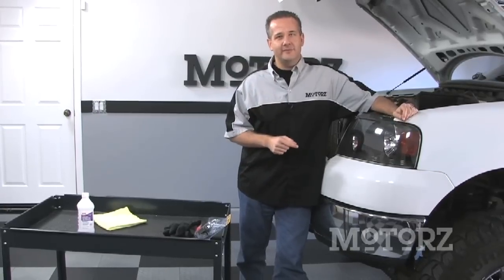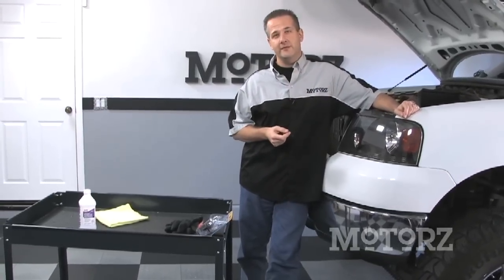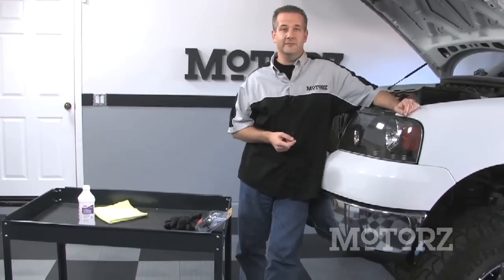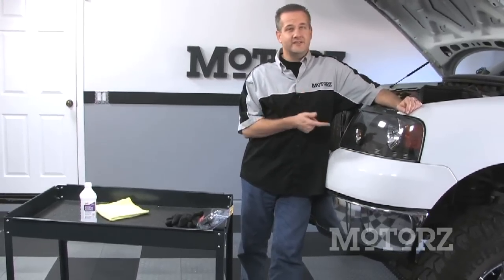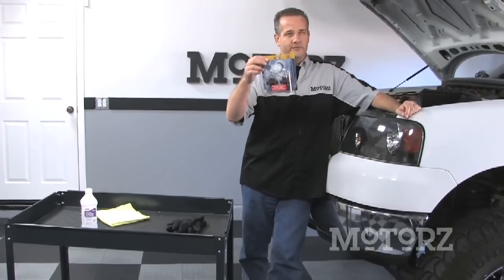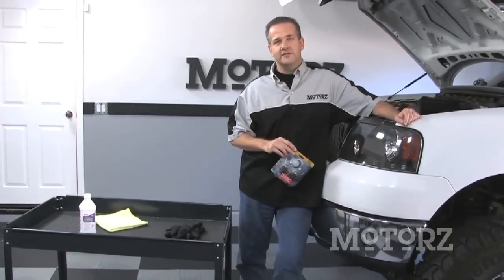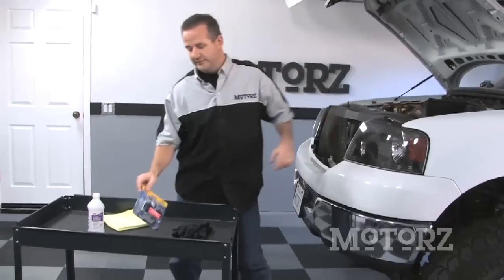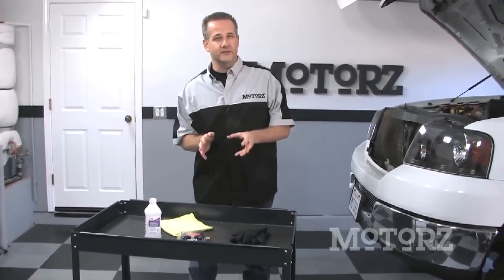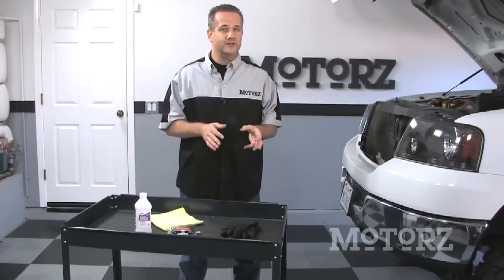As you may recall, last season in episode 22 we upgraded our 2005 Ford F-150 pickup truck with awesome LED taillights, as well as headlamp replacements from Hella. The stock bulbs are still in there, so let's upgrade one of them with Hella's H13 Xenon Blue bulbs, and then I'll show you the difference in the amount of light. First, let's talk about proper handling of bulbs - it's extremely important that you don't get any oils from your hands on the bulb's surface, as it will create hot spots and decrease its lifespan.